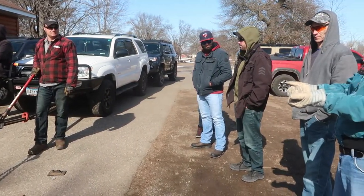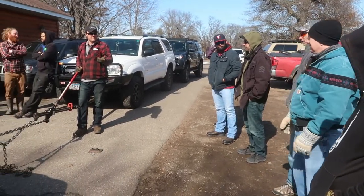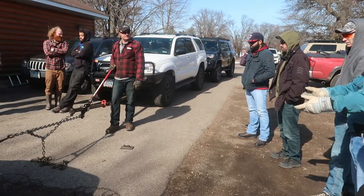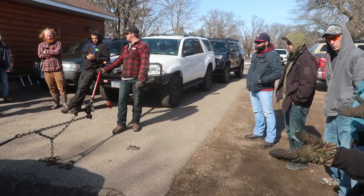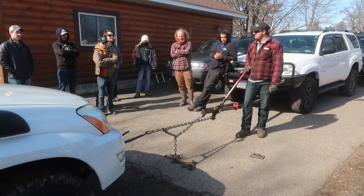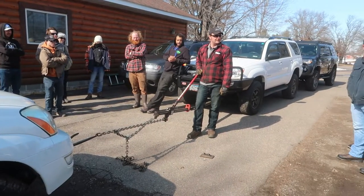It hooks onto the tire. It's got hooks to hook on rubber, the wheel rubber itself. Rubber covered metal hooks. Yep, and it hooks onto the aluminum wheel or steel wheel if the holes are big enough. Then you can just lift it up that way and get stuff underneath. Logs, rocks, sand, whatever. Because what happens is it actually lifts everywhere else. The wheel will drop back down with you. So then you're all the way up the top and you're like, damn suspension flex. The wheel's still on the ground.